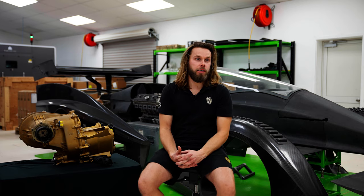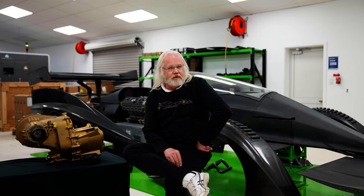It's a plate-type limited-slip diff, and we can adjust the hydraulic pressure to very precisely control the action of the differential. The gearbox weighs around 68 kg. It's a full eight-speed sequential with a hydraulic diff, capable of carrying a thousand Newton metres of torque. For the amount of power and torque the engine's got, it's very light — much lighter than most others.